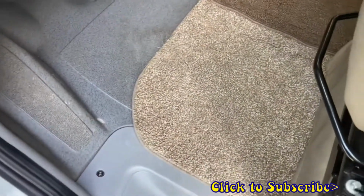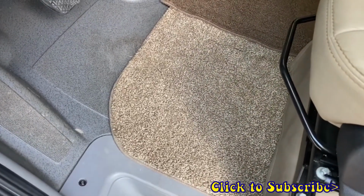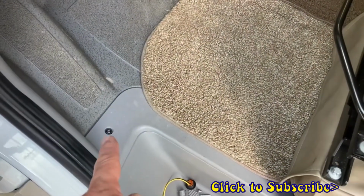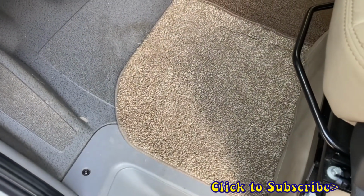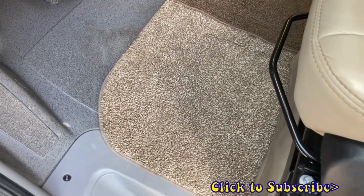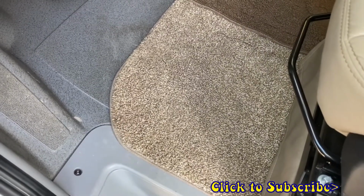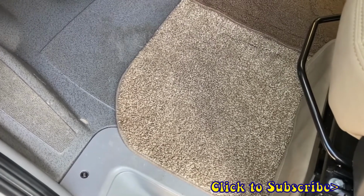And I just want to thank you guys for watching today. I know it wasn't a full instructional video, but hopefully I hit the highlights, and if you have to change your Sprinter battery, you should be able to do it yourself. The tools needed: we had a T25 Torx bit for these 3 little screws in the trim there. Then we had a 10mm socket, your ratchet handle of course, and you'll need a long extension. That long extension is to reach down to take off the bracket that holds the battery in. But other than that, that was the only tools required for this job. So overall, pretty simple job, just a couple of tools, and didn't take us very long at all to finish this job up.